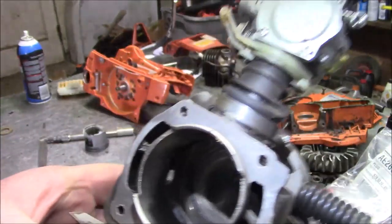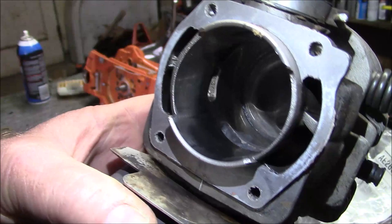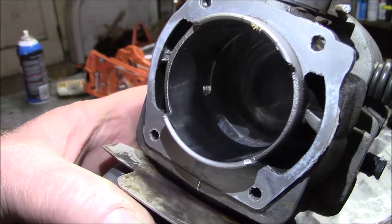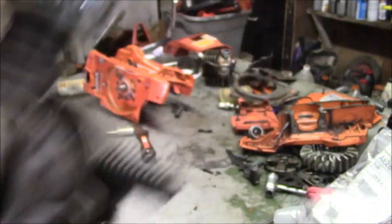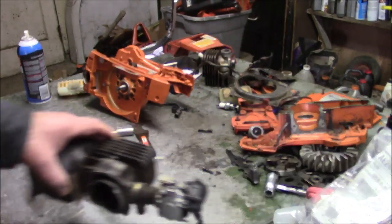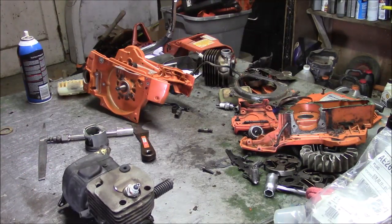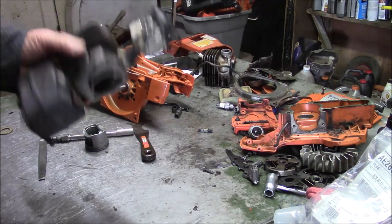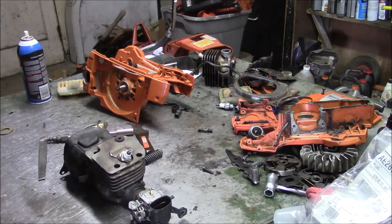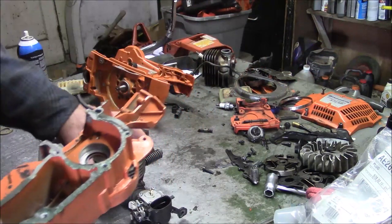right above the exhaust port there, that shows it well. You can see that V shape right there, kind of highlighted. Well, you know what that is? That's the plating peeling off. So that top end did not survive the test of time any more than the cases did, where the bearing pocket opened up on the thing and it won't hold the bearing anymore.